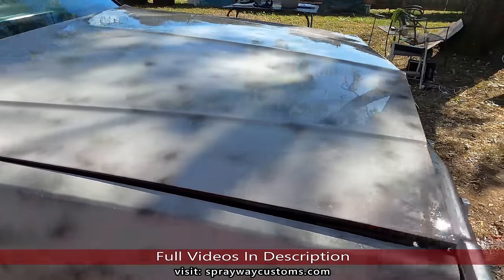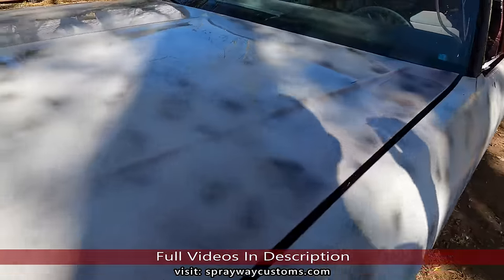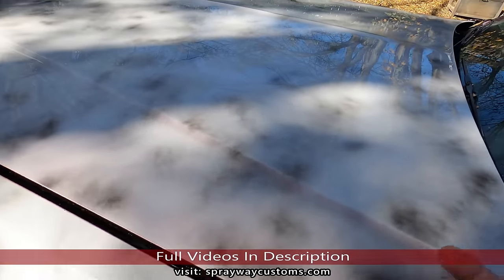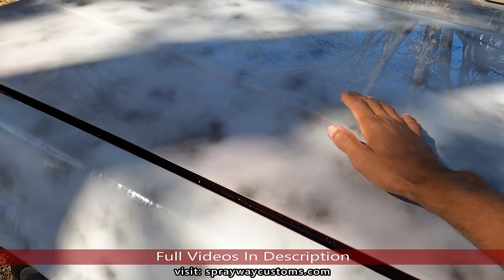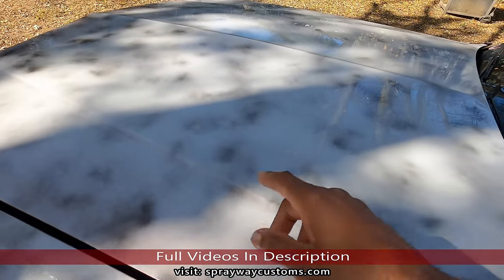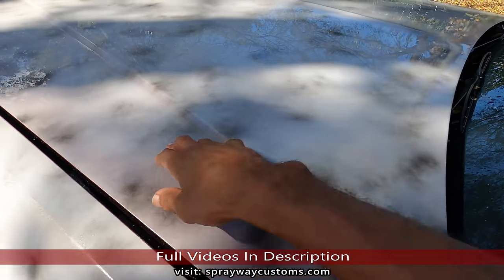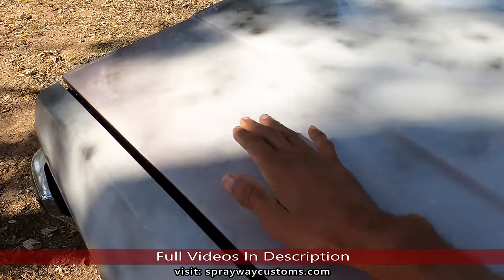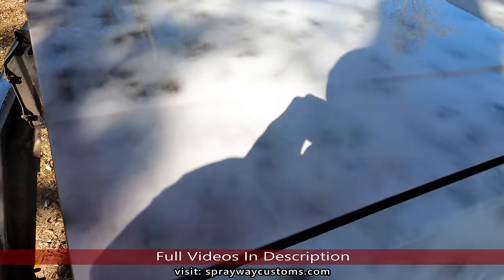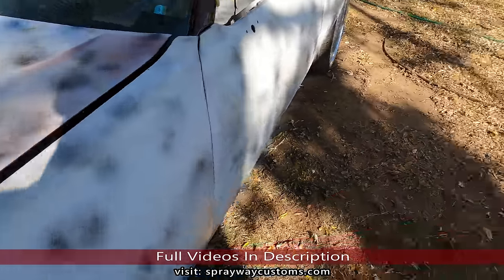If you ain't wet sanding in a covered area, like I'm doing it outside, and leaves started falling on it again, you wanna make sure you keep the surface clean, especially the flat areas here. Because if you don't, trust me, see a leaf just fell right there. When you start sanding, you're gonna dig into it. It's gonna be some grit on it, and it's gonna put a deep scratch in it. You're gonna see it once you start spraying your base coat. So you wanna keep those areas clean. Let me show you what sandpaper we're gonna be using. I got it over here.